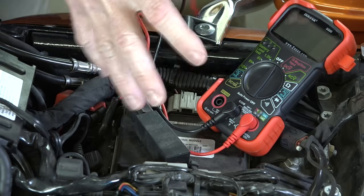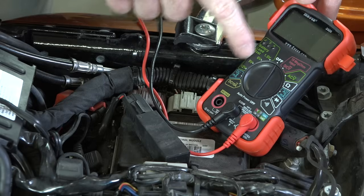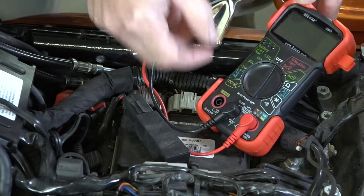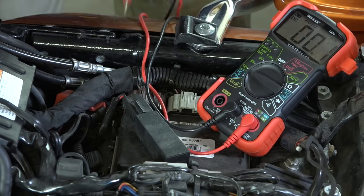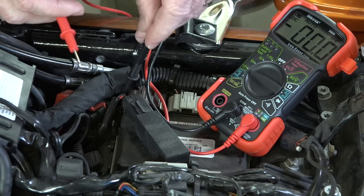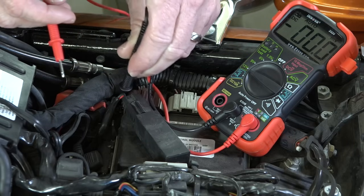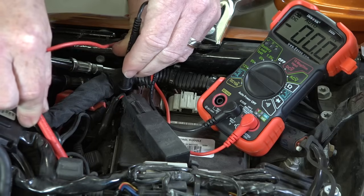Regardless of what kind of meter you're using, we wanna use volts. Of course, this is a 12 volt system, it's labeled. This is your volts over here. I'm gonna turn the wheel to 12 volts, it's on there. All right, I'm gonna take the negative to the negative side, and the positive to the positive side of the battery.